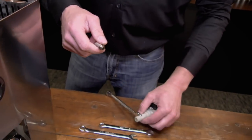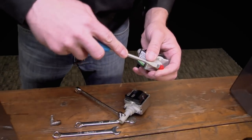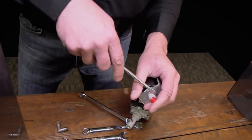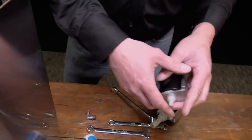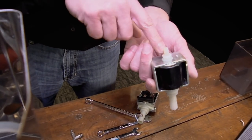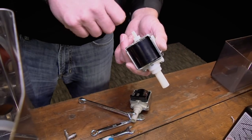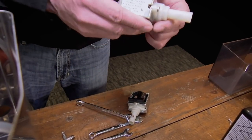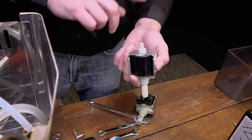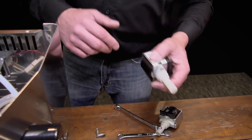Now we've got the elbow off — we'll put it on the new pump. The new pumps come with a cap on the neck and a cap down here. This one is usually a little bit more of a pain, so I'll use my flat blade screwdriver and just wedge it off and around. At this point it's also a good trick to use a turkey baster or air compressor with a nozzle to force air through this side of the pump in case it's seized up from sitting with water in it. If you force air through it, it'll shoot out the other side and you won't have a lockup on the pump. If you can't do that, it's not a big deal — you can still do force priming if the pump won't take the water.